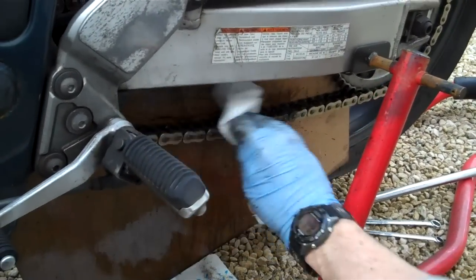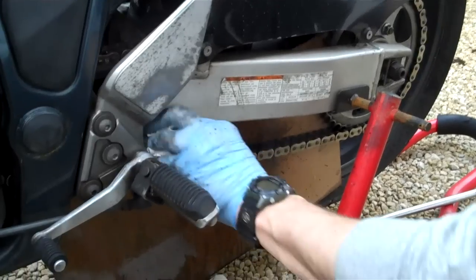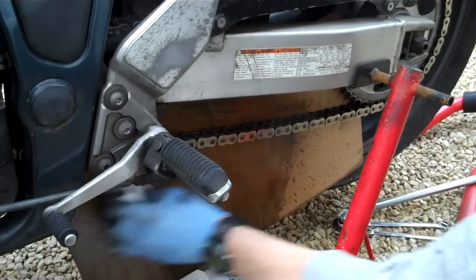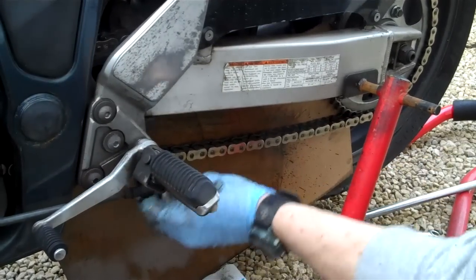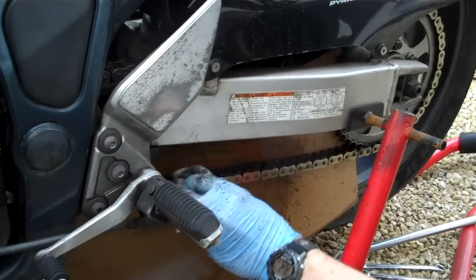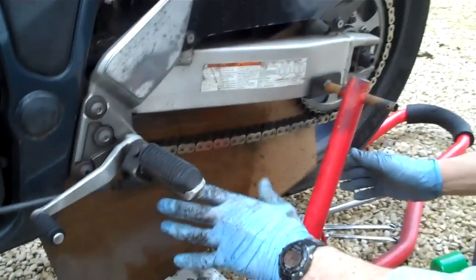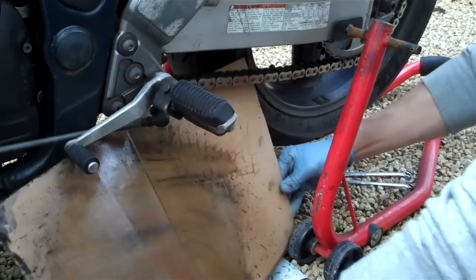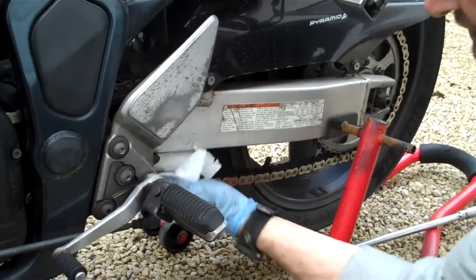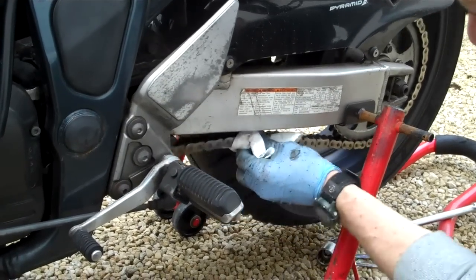That's pretty much it. It's nothing new, it's not difficult. There are a lot of chains out there that clearly haven't had any maintenance. It seriously matters because a chain is an expensive component — you can pay £125 for chain and sprockets, and if you can make it last twice as long with a bit of this, that's a sensible thing. I've used about a quarter of the can and an old toothbrush, and that chain is as clean as it needs to be. Get all the old chain lubricant that contains road grit and salt off — it must come off at regular intervals.